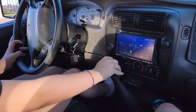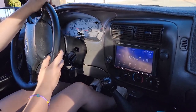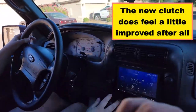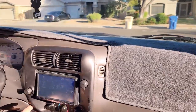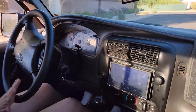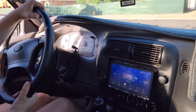First gear. You need to get faster at judging when that clutch engages, and right when you're lifting up, start giving it throttle and it should be smoother. You need to mentally note where it started grabbing. That's definitely closer to the floor — yeah. I think it gives a little more travel over the total time it starts grabbing. Jason said his Tacoma was the same way, so I'm just not used to these newer vehicles — the older cable ones used to be closer to the floor.